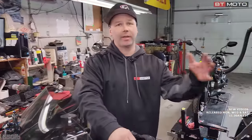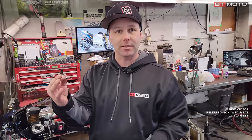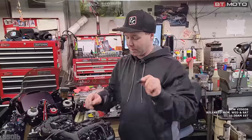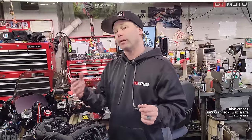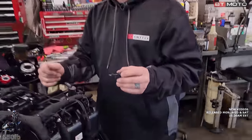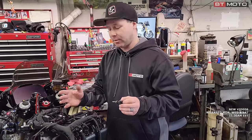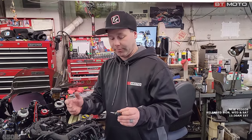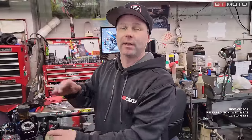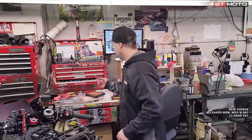When it's here, you've got the gas tank, you've got your fuel, this is all getting hot. So what happens is this gets heat soaked, is what it's called. So instead of it saying it's 80 degrees outside, this might really read 120. When it says 120, there's built-in fail safes that the bike's going to detune ignition timing, maybe fuel a little bit, run a little extra rich to make sure that nothing bad happens to the engine. Well, through testing, they found out that it is still safe. We can get that actual 85 degrees, and it's not going to give you more power, but it's going to keep your horsepower more constant on a hot day. Makes sense.